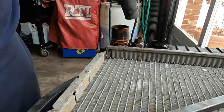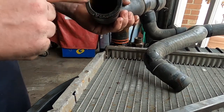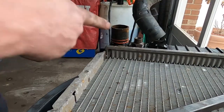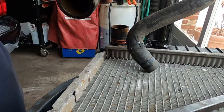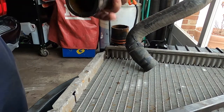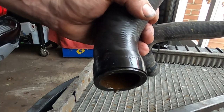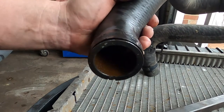And there it is — but it took some doing. Basically this metal piece has to come off with the hose, not stay on the radiator. Now I'm not even sure if the radiator hose is still sealing. Probably be a good idea if you're doing these to go ahead and replace this hose.